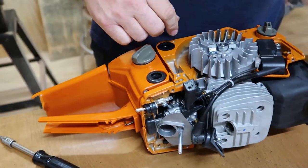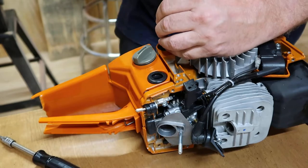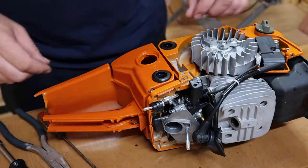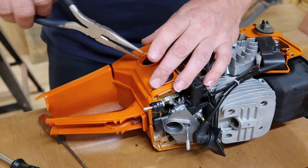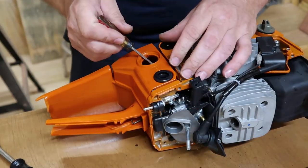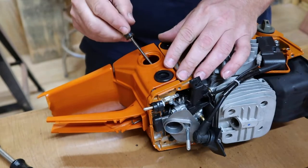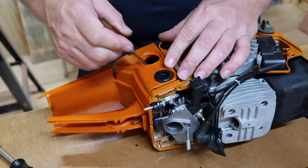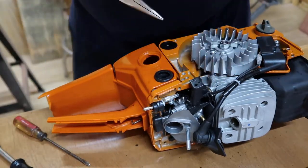All right, down in here, there's going to be two Phillips head screws. All right, y'all, next thing we're going to do is try to fish this line of this fuel tank here. I've got to take the filter off and pull this line through the gas tank itself. It's probably going to be one of the harder parts. Just getting that fuel line out.